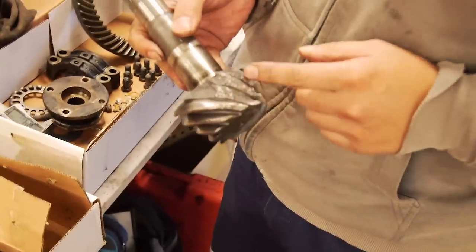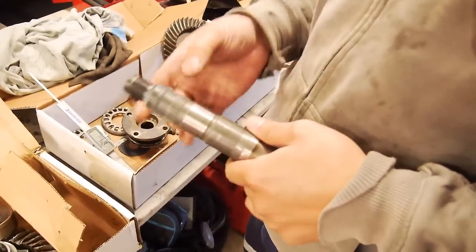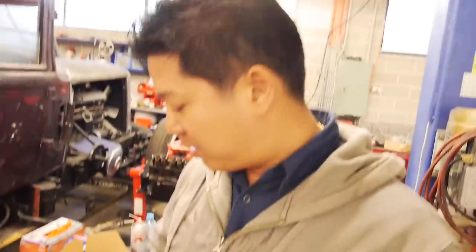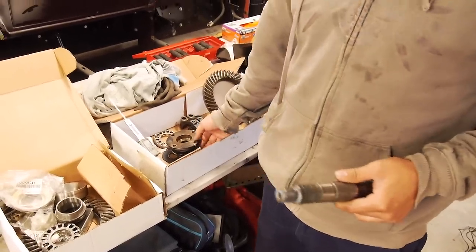We've cleaned all of them off. But to the point, this side here has 29 splines, which makes this section a bit thicker and also incompatible with this drive flange, so it doesn't fit. If we were going to order the Nitro gear set for the surf, we'd have to get a new flange coupling or one from a Prado 120. Also the universal flange that's sold in the States for their Toyota applications is the wrong PCD for the drive shaft that's in the surf. So we had a whole other set of issues and problems.